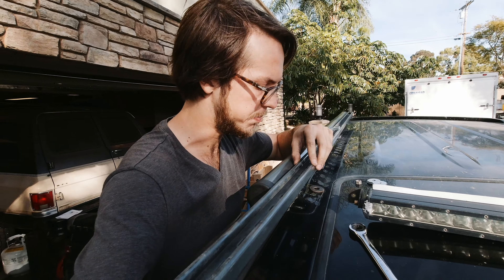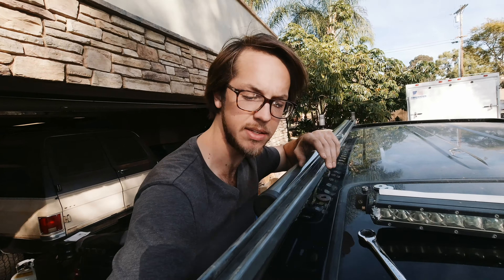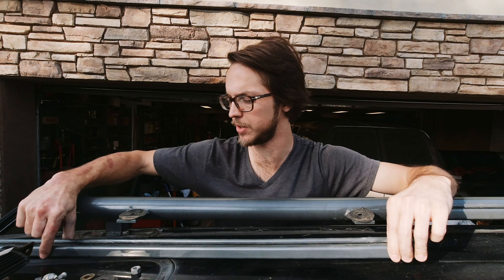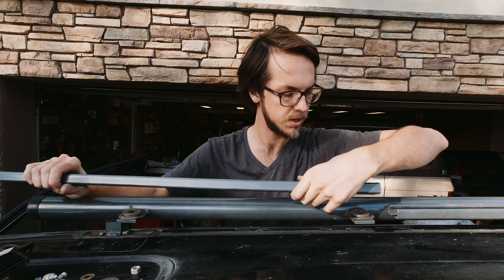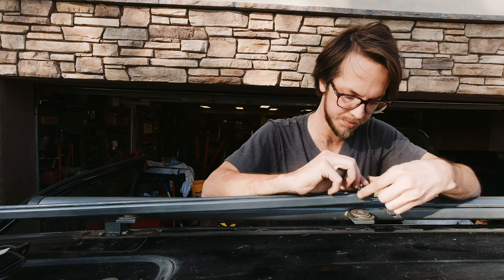I'm figuring a lot of this out on the fly. I've decided I'm going to take my old crossbars and reuse them to save money. I'm going to run them the length of the roof. The T-nuts that slide into these channels is what I'll use to actually fasten the crossbars, so I can put the crossbars anywhere I want rather than fixing them to the welded tabs. If I were to make this rack again, I'd probably just build in Unistrut rails full length. I always use rubber washers when bolting onto things that are powder coated to preserve the finish. I need a couple washers as spacers to raise this up — it's not quite tall enough for the new crossbars to clear the bars.